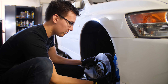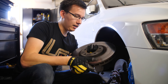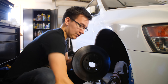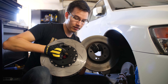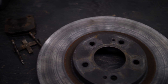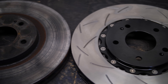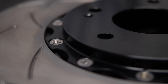This is what I'm working with right now as far as the brake rotor — just a blank generic brake rotor picked up from a local parts store. And this is the new rotor from DBA that is a two-piece design. These two-piece rotors differ from the single-piece generic rotors on the car pretty significantly. As a two-piece rotor, the top hat is reusable. Once the rotor rings have worn away, you simply remove it from the top hat and replace it.